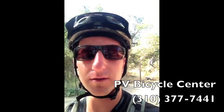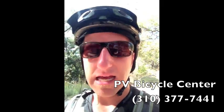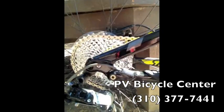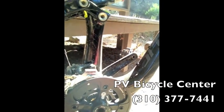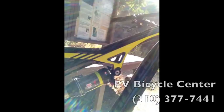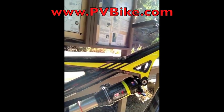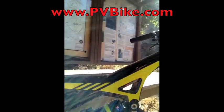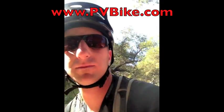I'm going to go about 15 to 20 miles. The bike's right here. It's all X9 build, 2x10, BB30 bottom bracket, RockShox rear shock with the custom auto-sag feature right here. You can set your sag without having to mess with it — just fill it all the way up, sit on the bike, push the button and it stops where it releases, and your sag is set up pretty much perfectly.